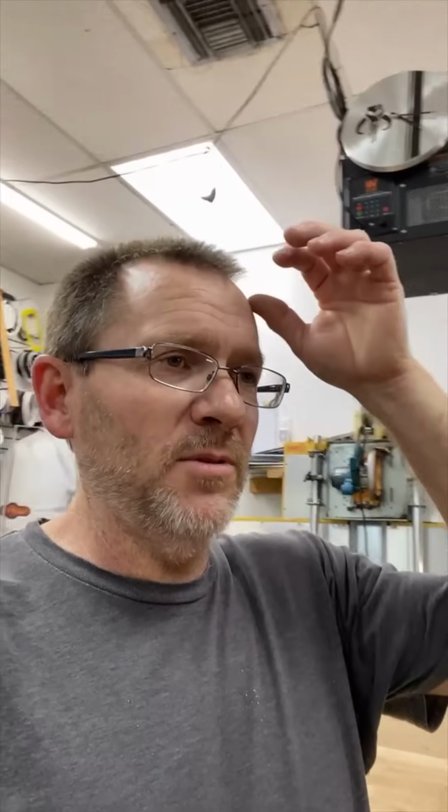Front, back, and down firing subs in a truck, two 10s or 12s. I'm a 10s guy in a truck. If it's going behind the seat, there's a couple different things you can do. Front firing always seems like a waste of time to me, but that's what everyone always does, ourselves included, because that's just the boxes. If you're custom building your box, if you can backfire the woofers, it's basically like down firing them, but firing them towards the back wall and make that back wall super rigid. It's kind of a nice thing to do.